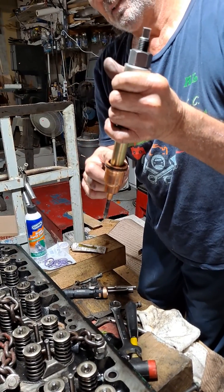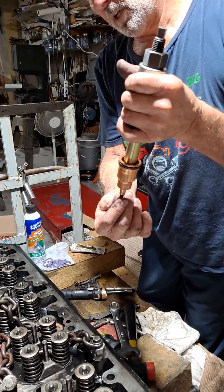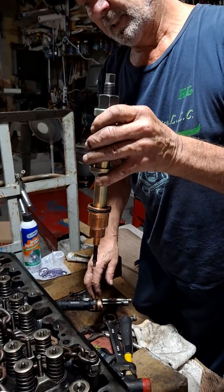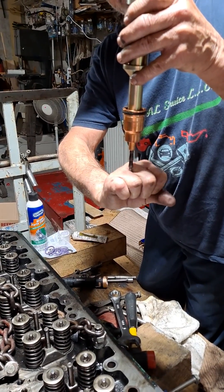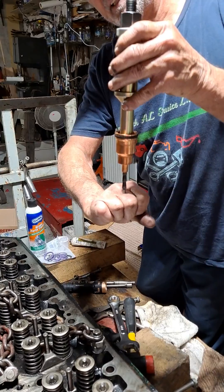You need to put a little bit of lubrication, just a little bit of O-ring sealant here, maybe a little there. Make sure your holes are all cleaned out before you put this in. Make sure your piston is not up at the top if it's on the truck, because the bottom of this goes through and will hit the piston — make sure the piston is down. If you have to, crank the engine over a little bit to get the piston to go down. Then put it in, and that's pretty much it.